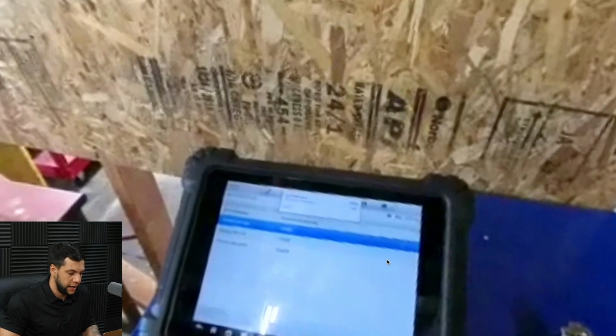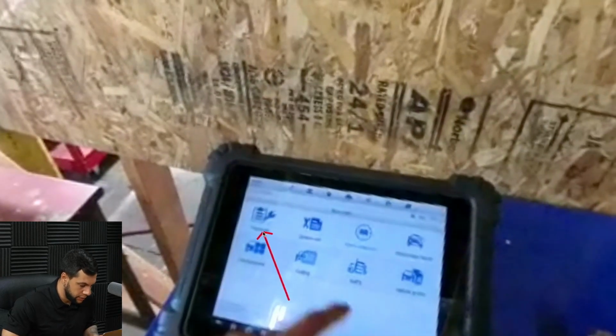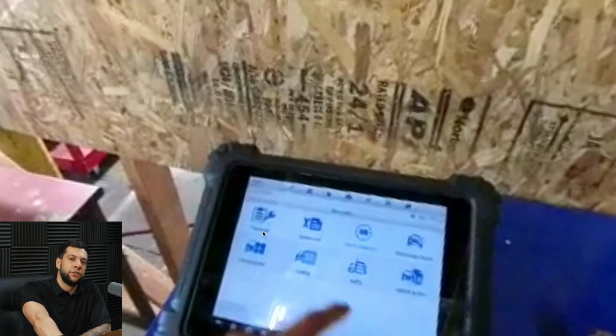So I took a screenshot, and then I'm gonna take another screenshot, and now I just hit OK, and I'm getting back to the ADAS calibration menu right here. Now I'm gonna escape, and I'm gonna do the post scan. And as you guys saw on the pre-scan, this isn't gonna change. The only difference is that it's not gonna ask you the mileage and the license again because you already did this on the pre-scan. It will do a full scan of the vehicle. You will be able to attach on the pop-up the photos or the screenshots you took. Also, if you have any history problem or history DTC on this car, you will be able to erase it and give the car as clean as possible to the customer, okay?